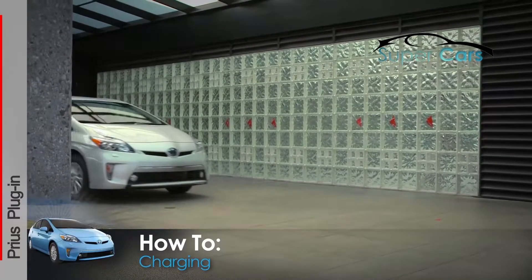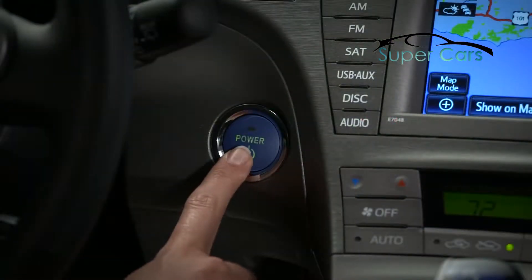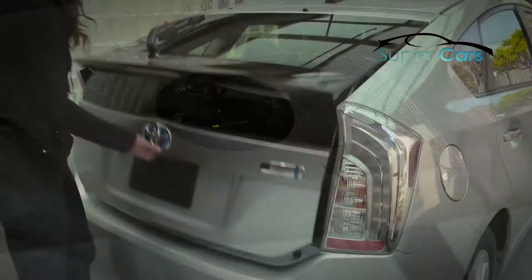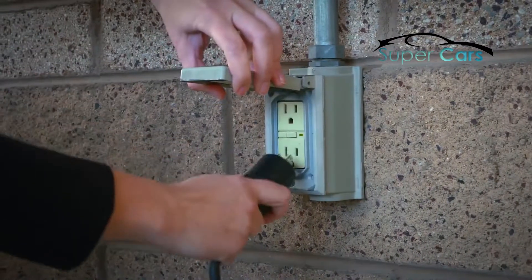The battery can be fully recharged in 3 hours or less when plugged into a 120 volt household outlet. Turn off the vehicle power and switch off any lights you may have on. Plug the supplied 120 volt charging cable into a household power outlet on a dedicated 15 amp circuit.